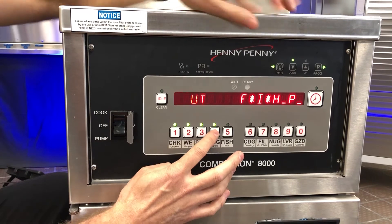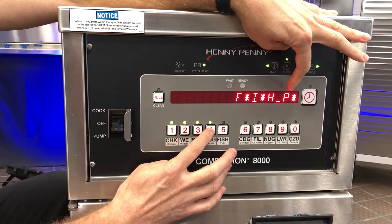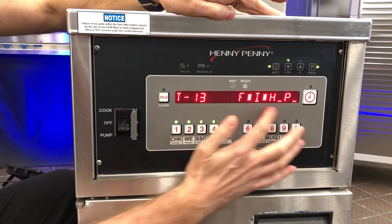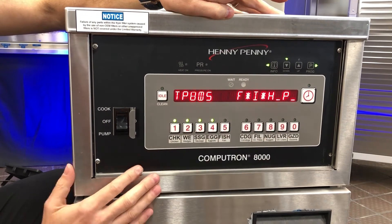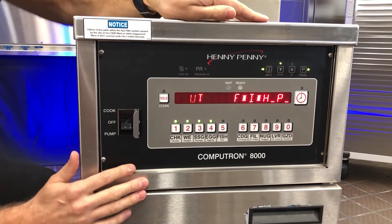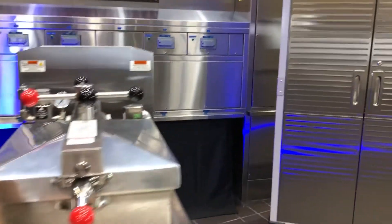I can hit the number four button to activate it. You'll notice we have an asterisk beside it, meaning that it's activated — and deactivated. Numbers one, two, and three are going to be for other components in your outputs testing and tech mode. But we're going to focus on the pressure solenoid right now, so I'll go ahead and press number four. The asterisk comes on.